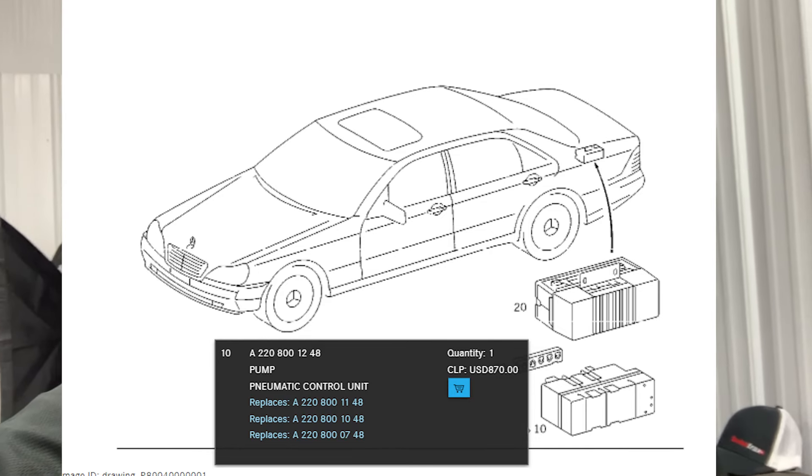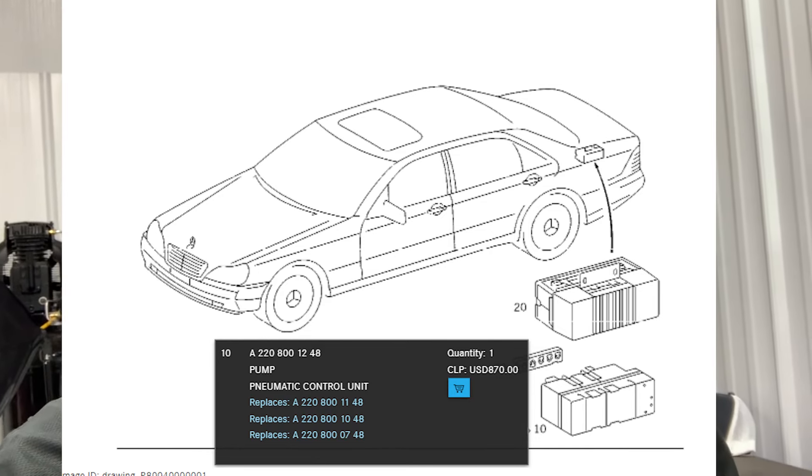The next question is: can I buy this used or should I buy it new? You can find these used — there's a part number on the PSE, and any PSE for the CL and the S-Class will work. However, if you get it from a CL like a 215 body, you're gonna have to have it coded — not programmed. There's a difference between coding and programming. If you plug it in it will work, but it's gonna set a fault code for the rear doors since there's only two doors on a CL. If you get it for an S-Class, it's gonna work — the trunk and everything. They're pretty much plug and play. If you do plug it in and it does have an issue, it might just be coding, which is basically hooking up a scanner and checking settings to see if it's turned on for the specific car.